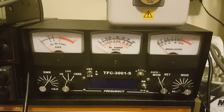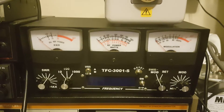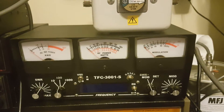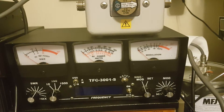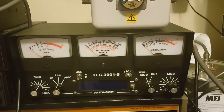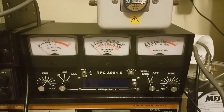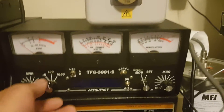On high he's got it set at about 60, which is okay, but you really want to get it about 50 to 55 because it gives a better modulation swing and it's much louder. Once I get this done this radio is going to be rocking and rolling. Now let's see what this radio can do.